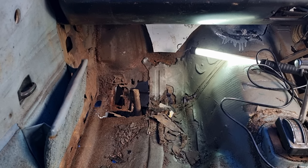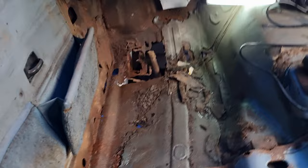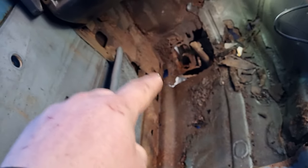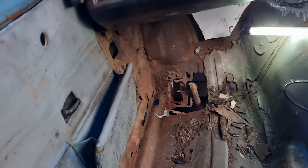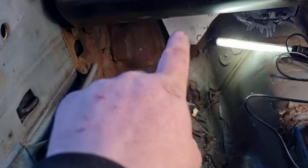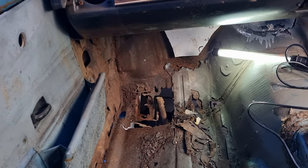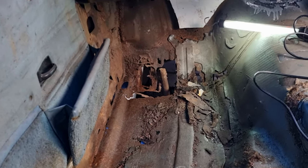I'm going to start cleaning in there because I've got a weld in there for the repair on the bulkhead. I figured why not just get rid of all the rust that's in there, give me a good surface to weld to, and maybe clean some of that up in the footwell while I'm there, get some rust treatment on there, and then when I come to weld my metal in I'll have a nice area to work with.